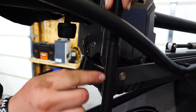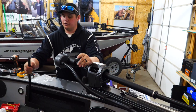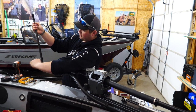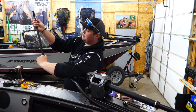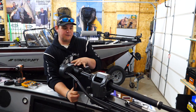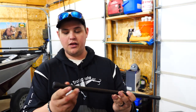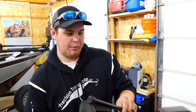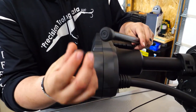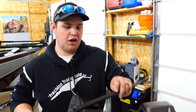It's obviously sitting on the floor down here and the threads are going to thread all the way up on this piece right here. It's looking like I need to cut about that much off — I'll measure the distance from here to here, and that's what I have to cut off on the bottom of this post. So when you bring the electric motor back up and it clips down, it's sitting nice and firm on the floor. Once you get it cut and know it's exactly the right length, there's a little rubber cap that I glue right on the end of it — it's a nice soft spot on the carpet so you don't have to worry about it cutting the carpet.